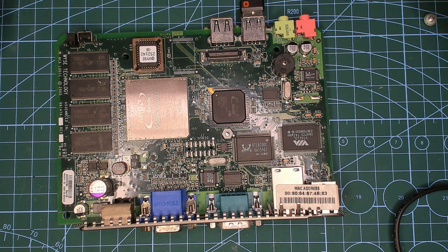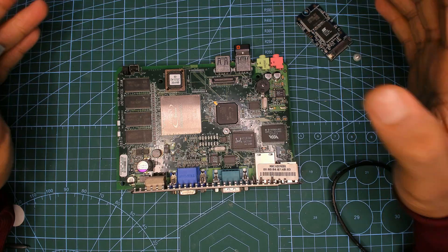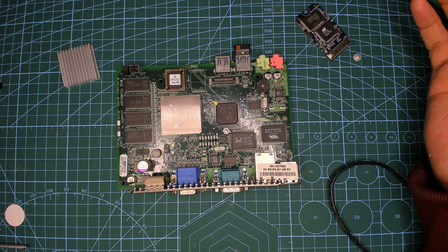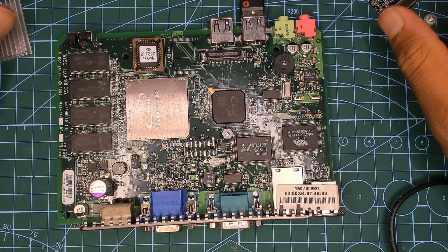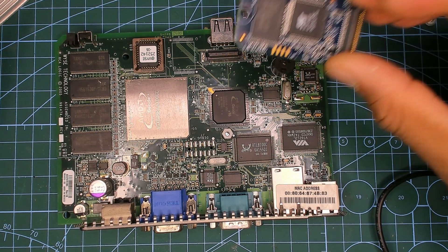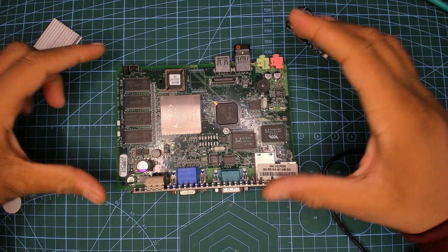I tried NetBSD — it boots, but the RAM is too slow or too little to get into the installer. I'm sure it would work with pre-installed media, but I have nowhere to connect that media. USB boot doesn't work properly; I was booting through a DVD drive over USB. NetBSD didn't work, OpenBSD apparently did work, but there wasn't enough space to install it and I couldn't get OpenBSD to DD from there to a USB drive. So it was not a good experience booting non-DOS stuff on it.